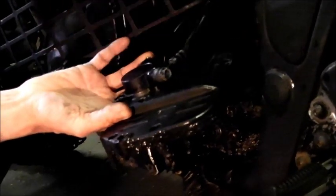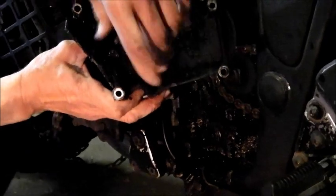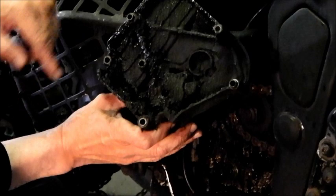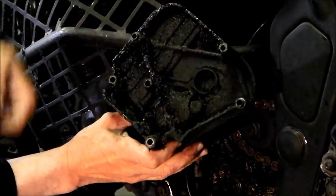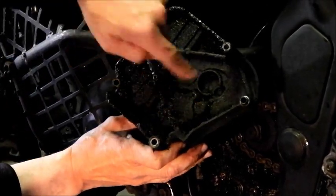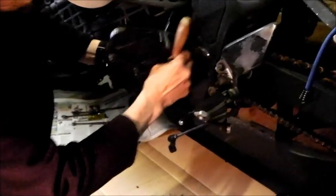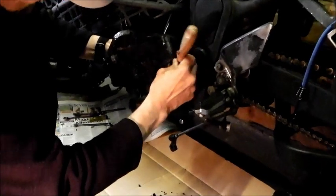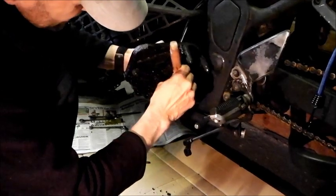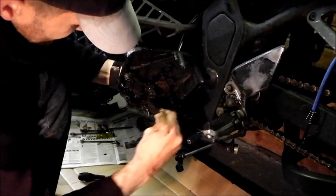Normally I'd break that seal, take the hose off out of the way, and then take the entire cylinder out. But what I'm going to do is leave that plumbed in for now - when the retaining clip is off, I'll take it out. I'm going to pump the piston out using the fluid, which is just the simplest way. So the next thing to do is clean this up in here so I can get to the back of the cylinder. I haven't got a cat litter tray, so I'm just going to use this cardboard. This is just chain lubricant and other stuff that gets in underneath there - it's pretty nasty.